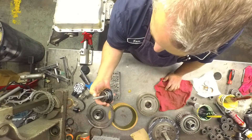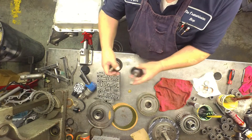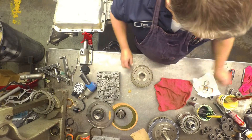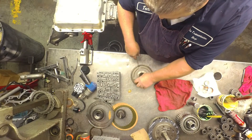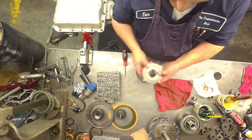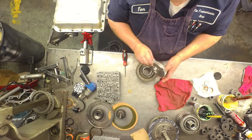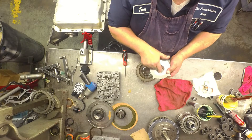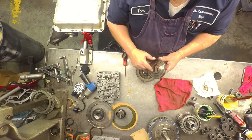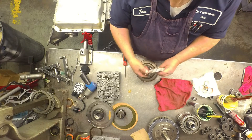Put in a no-groove servo — the groove will be down in the kit. The kit has you drill two 62-thousandths holes right here. There's a little notch on here, and I just drill my holes where that notch is. I drill it from this side — I found that you break fewer drill bits if you drill from this side. Then once that's all drilled, go over to the grinder and grind that down, making this notch bigger than what it was. Make sure you sand out here; otherwise it'll rip that bushing to pieces.